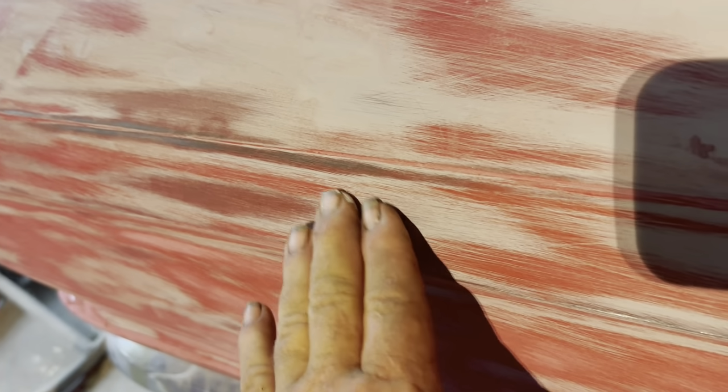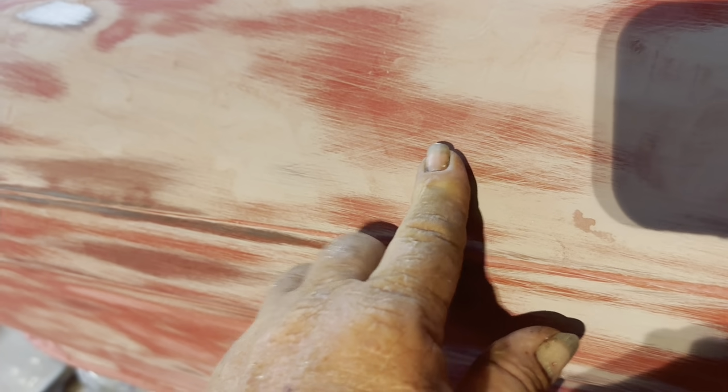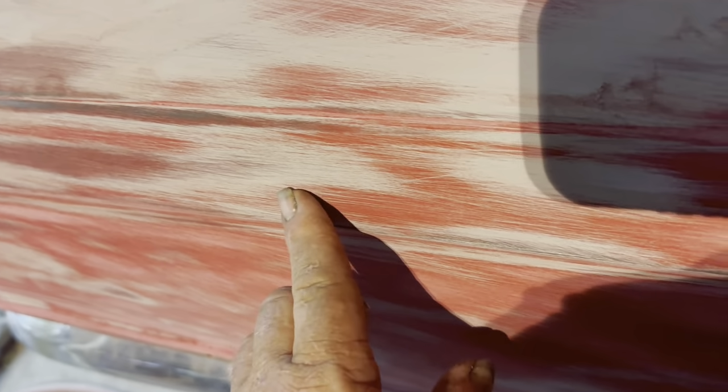Okay, so what determines whether you can do a car like this or not is how the paint feather edges. You see how it's sanding back and it's not peeling back? It turns itself almost like primer, where you can sand through it, and it's not peeling, it's not leaving hard, weird edges, okay? If you're sanding and your paint is peeling back off the primer and it didn't adhere like it should have, okay, it isn't gonna work.